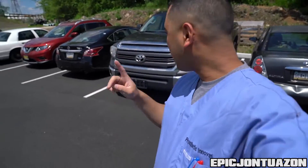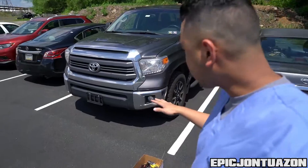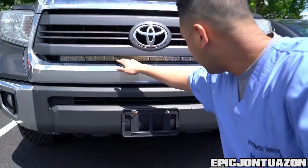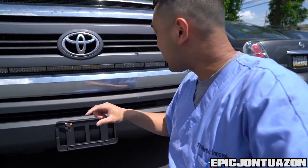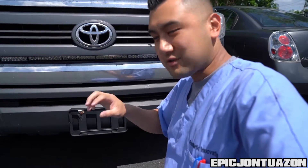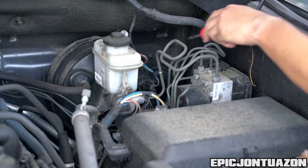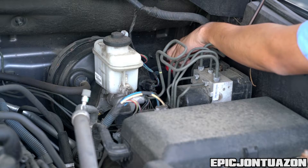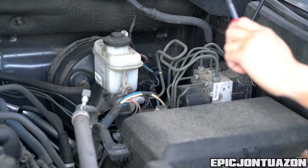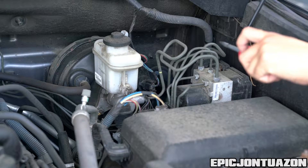What's up guys, day two. We're with the 2014 Toyota Tundra. Just to recap, we installed the light bar as you can see right here in the front. Now we're gonna run the harness — hook it up to the light bar, run it through the firewall, and hook the switch up on the interior. I'm going to use this grommet that goes through the firewall, puncture a hole, run a fish wire through, and pull the rest of the harness through into the cabin.